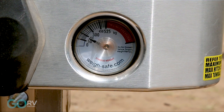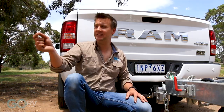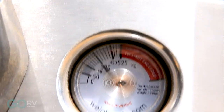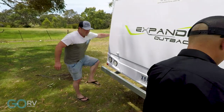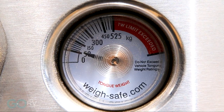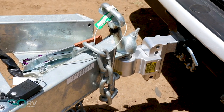But now, because people like to really load up their draw bar, let's go to some extremes. Boys, onto the A-frame. And now, same point again, let's get the guys onto the back of the van. What a difference — and what a clear case for why it's so important to load correctly and to know your ball weight.